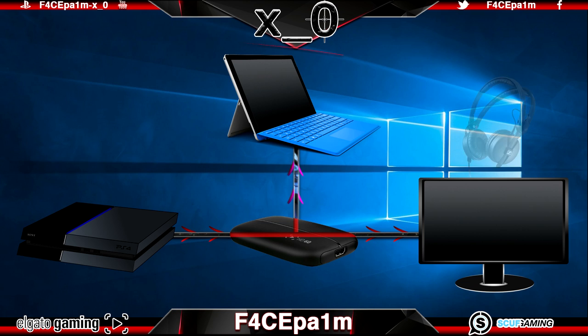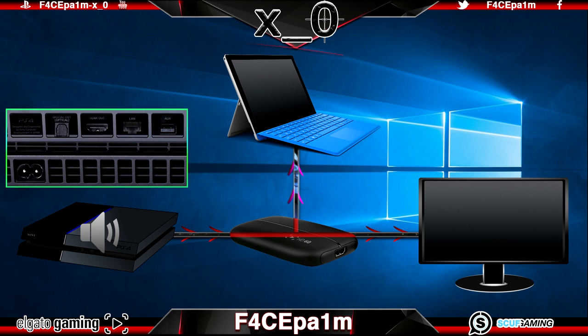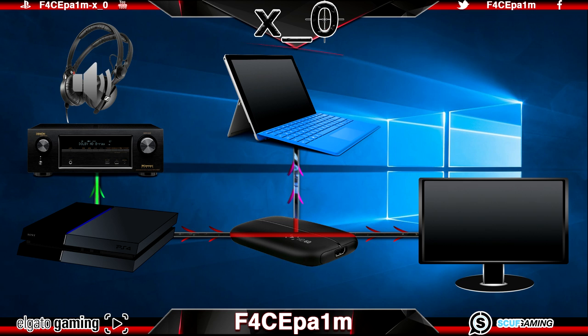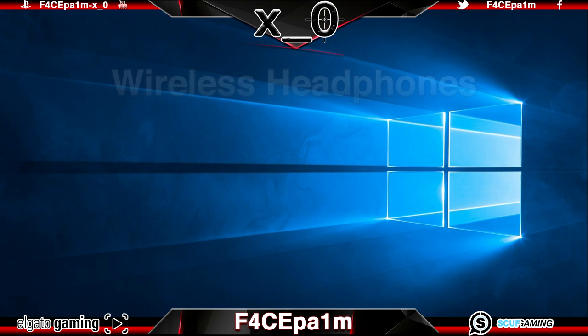If your TV doesn't have a headphone output socket, you will need to send game audio from the PS4's optical output port on the back via an optical cable into a mixer and amp and speaker combo — i.e. a home stereo with an optical input, which could use either ADAT or Toslink ports. Then plug your headphones into that home stereo's headphone output jack. This setup can be quite good because it lets you switch between stereo speakers and headphones by flicking a switch. I'll show you which settings to change after I cover wireless headphones.